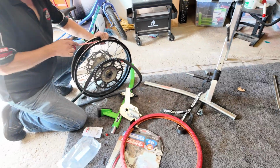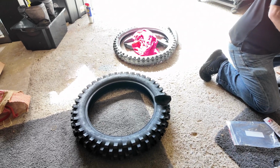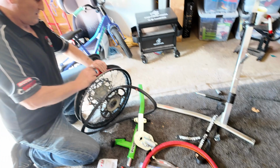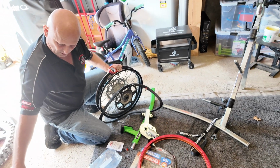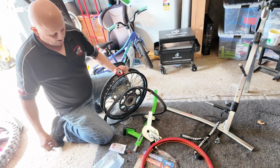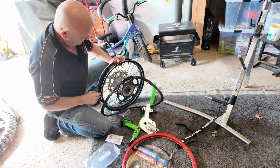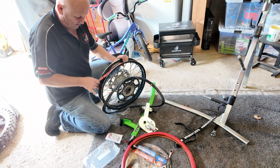Yep. And then you've got ambient air in your tyre, and however hard your sidewall is, and then 100 psi on the inside. So the inner one here will be at 100 psi to help seal and hold that in place. And then the second valve, which you see here, will allow you to inflate the tyre to whatever normal tyre pressure you like to run.